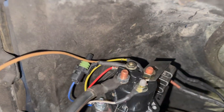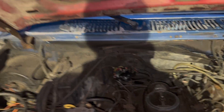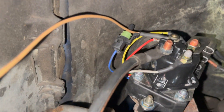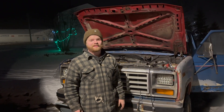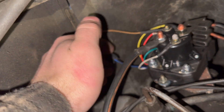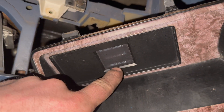That little brown wire there is my signal - I just tied into my fuel pump wire. It's only low voltage that feeds that little bit of signal so it won't hurt to piggyback off that, plus they're both on with the key, so it works out fine. The only one left is that blue wait-to-start wire. Nice thing is you can use the original wait-to-start light from the 6.9 IDI with the 7.3 controller. This blue wire right here is my wait-to-start light - there's going to be output power coming from this and that has to go to your light inside the dash, the little light right behind where it says glow plug.